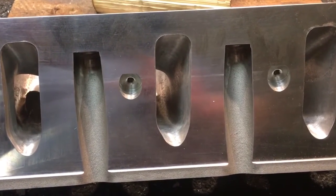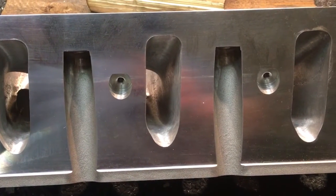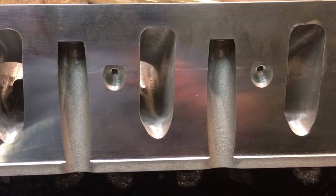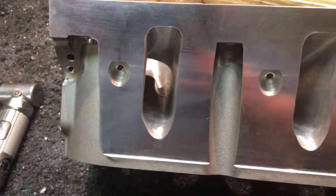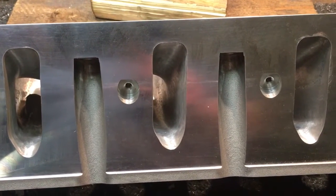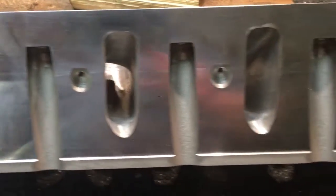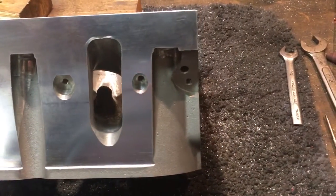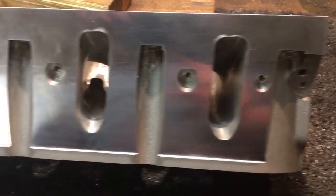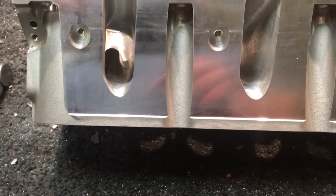I've just been using my double-cut burr to get that fairly rough casting line material removed out of these intake ports and knock off some of that rough finish. I'll hit it with some 60 grit flapper wheel material — I'll just go over the ports after I get all the material cut out and get a fairly uniform texture, then fly through it with some 60 grit on a flapper wheel just to give it its final texture. There's not a whole lot of work left, but there is time-consuming work still left to finish doing these port textures.